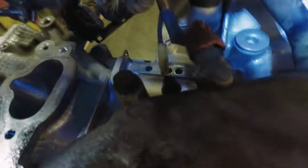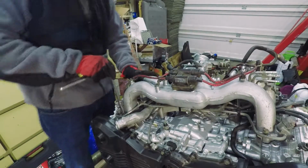There's a coolant line right here that goes to that tube, which is coming from that heater tube we just installed. And then you've got to plug in right here for your knock sensor. And the other two you want to get in are those two right there, the red one and that off-white one. And then that tube.